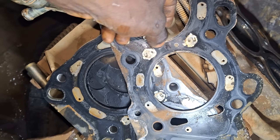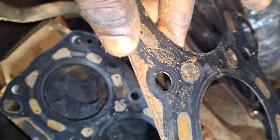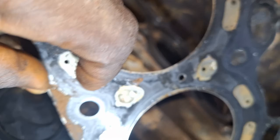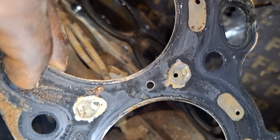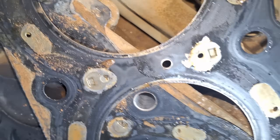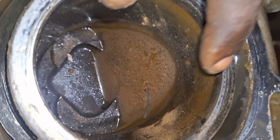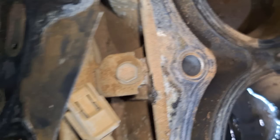Here it is — this is the part of the gasket that got burnt. This is where the mixing is coming from. You can see this part of the engine is where water was getting in. I think it's just this one cylinder misfiring. You can see this piece is quite drier than the other area here.